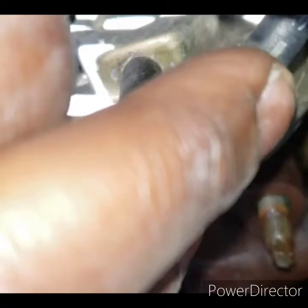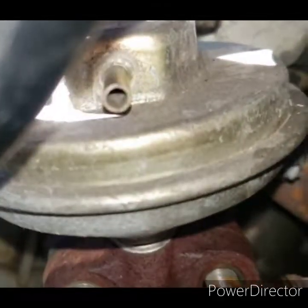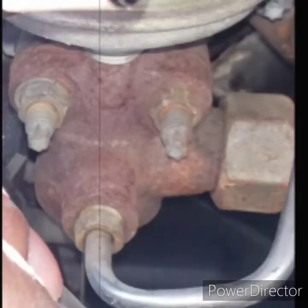Next up, take off the hose. Just disconnect it, let it hang. It goes around to the other side of the diaphragm of the EGR. So, the next thing that you want to do concerning EGR, let's say you took apart the line, right? Now, all you have holding that EGR valve in is two 12s. And they might have washers, they might not. But when you take off this EGR, look for a gasket that's on these threads that go behind the EGR where it bolts up to its EGR system, because there is a hole on the next side too.